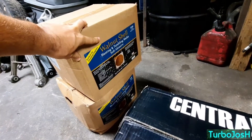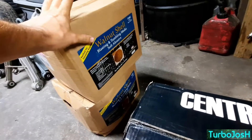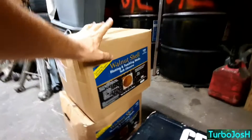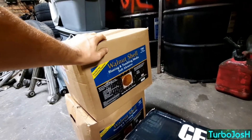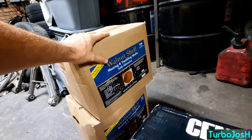You will run a shop vac in the same port to suck out all the dust, but it will be an absolute mess. This is fine-grade because a more gritty grade will eat away at the metal, which we do not want — we don't want to manually port the ports or valving on this stock EcoBoost. I'll cover more videos on the timing job itself, but it's pretty straightforward as far as taking stuff apart like a puzzle.